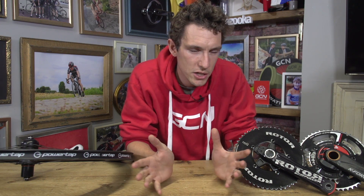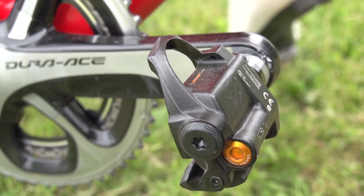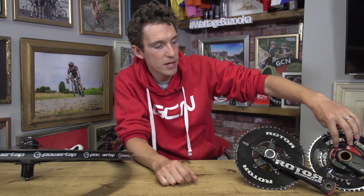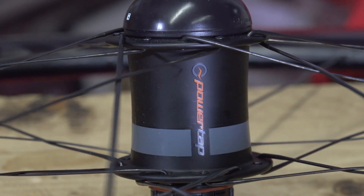So we've got our combination of strain gauges and accelerometers — now where do we actually put them? Well, here's where we as consumers get to choose. You can put them at your pedals to measure force and cadence. Similarly, you can put them on your cranks, or you can put them on the spider to measure the force between the crank and your chain rings. You can even put them on the chain rings themselves, or you can measure the force coming off your chain at your hub, like this PowerTap.